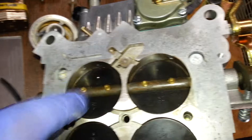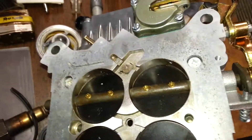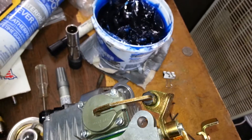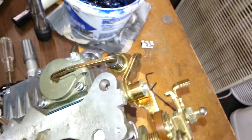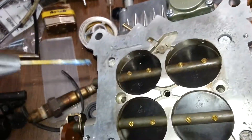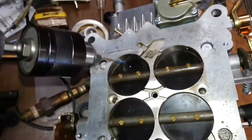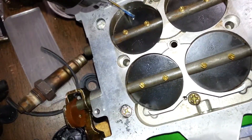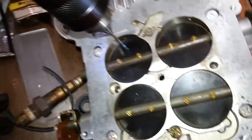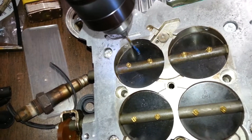Just as a demonstration — once you punch that, hold it with your finger so it's not going down, punch it in there so you've got something to drill. Because I do transmissions, I've got some trans gel — put that on your drill tip. Some grease, Vaseline, or regular axle grease will keep all the burrs from gathering inside the carb itself. Then just take this and start drilling with the sixteenth, I've already piloted a hole.